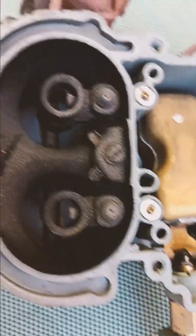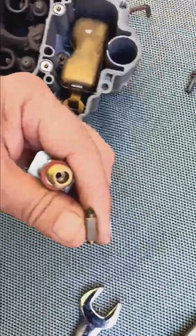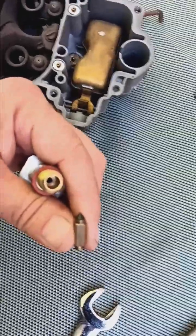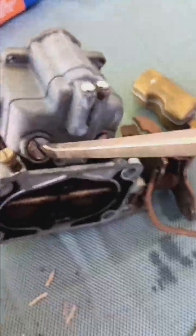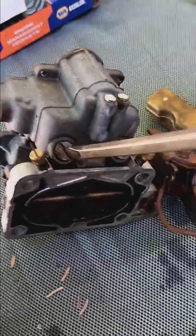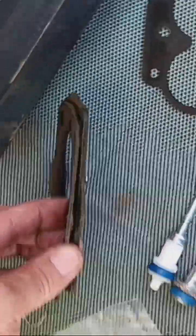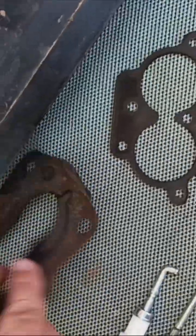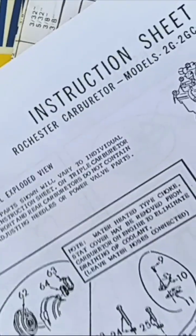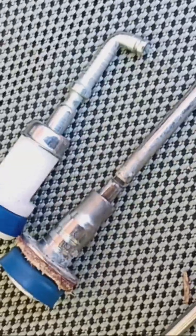So we're just going to continue with disassembling. There's the needle and seat — the new kit comes with a fresh needle and a fresh seat; I replaced this last time I was in here. Just continue taking apart everything that will come apart, remove any rubber O-rings and so forth, and get this stuff soaking in carburetor cleaner. Other than the base gasket, the current setup had three gaskets, so no one took the old ones off apparently — nothing works, fits, or interchanges, which makes sense because this is a Rochester kit, not a Stromberg kit. Not sure why I bought it; I probably bought it because I liked the looks of the accelerator pump, because it's definitely closer, but it still doesn't work.